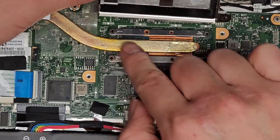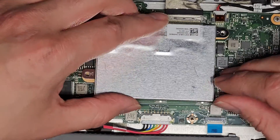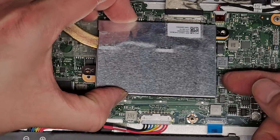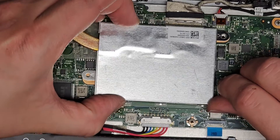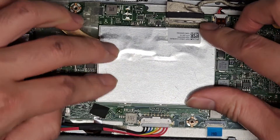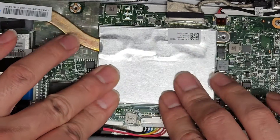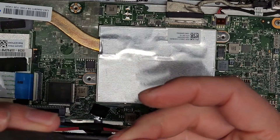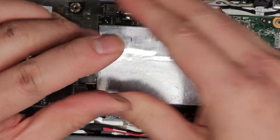The CPU is also soldered to the motherboard, and you can have access to the heat sink screws now. I'm just going to put this back down. If you don't know what you're doing, it's a lot safer to do this after disconnecting the battery and then pressing and holding the power button. Since you're messing with this metal box, you'd probably want to do that. Let's go ahead and get these screws back in — it looks like you can't really do anything with that. I'm just going to quickly go over what components I see in here and then remove the SSD.